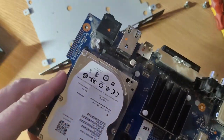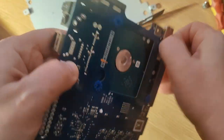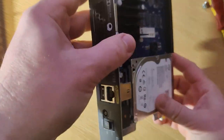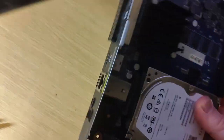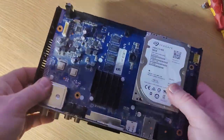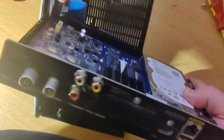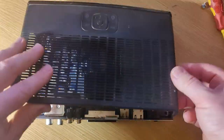Pop the screws back in through the rubber bushes, make sure it's nice and firm, then reverse the process — slide it into the lower tray so all the plugs and sockets line up. Sit it back on the bottom tray, making sure the front lines up correctly. Put the plug back in — these have little latch switches on them, so don't yank it out; press the switch. Easy enough — that's all back together.